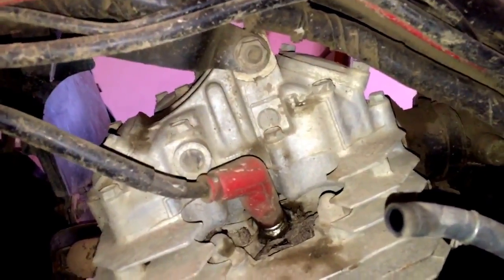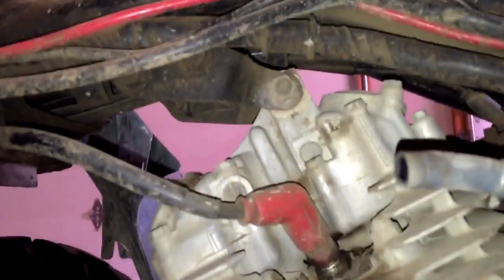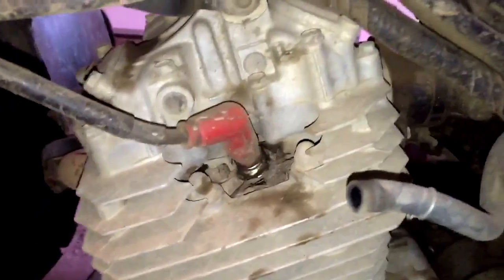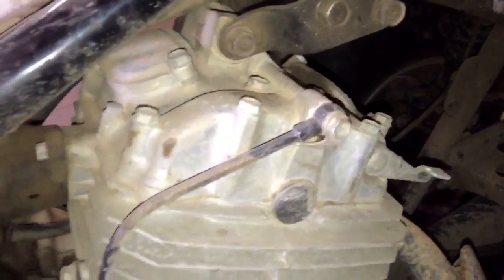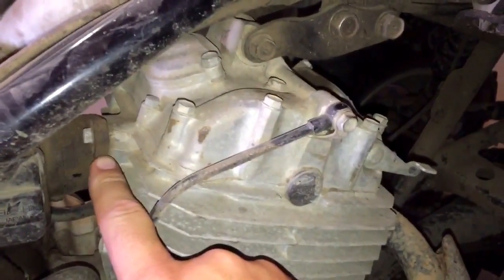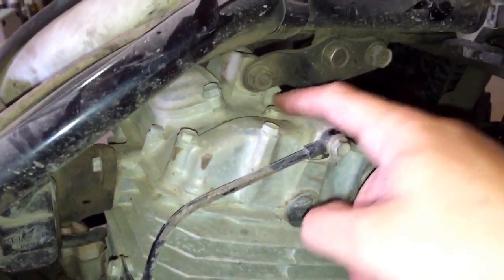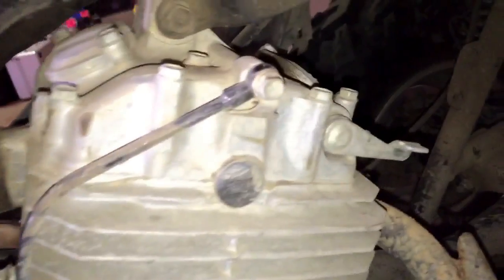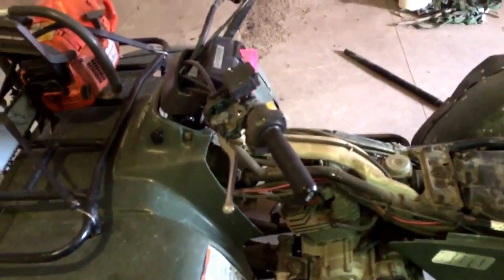So I pulled the tank off and I'm just looking at what we've got to do here. I think I can get away with leaving this air intake on there. What we'll need to do is unbolt that top motor mount right there, and then undo those small bolts on this side. Once I loosen off that motor mount, there should be enough room to lift up and get into there. No time for messing around today — got to break out the big guns.